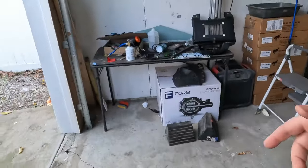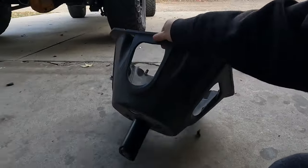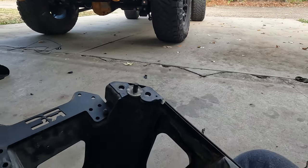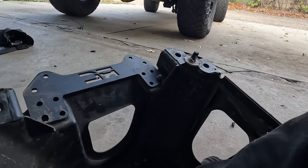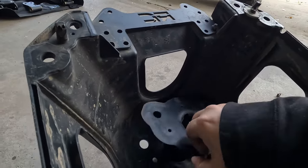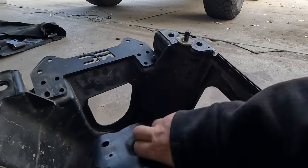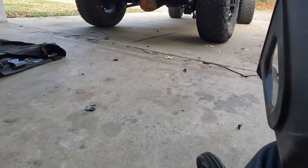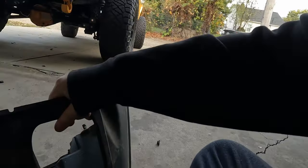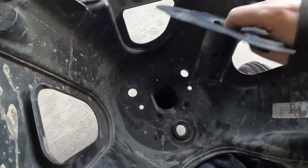Now, one thing in that video that has caused some confusion and I've had some questions about is actually removing the camera. There is this piece inside of there, and it slides in there like that. Now, that looked like it slid in there nice and easy and slid right out. It's glued or something from factory, or just compression fit. I don't know exactly how it's held in, but there are a couple of screws on the outside that will need to be removed. And then you have to get under and pry this out, and it'll eventually pop loose.